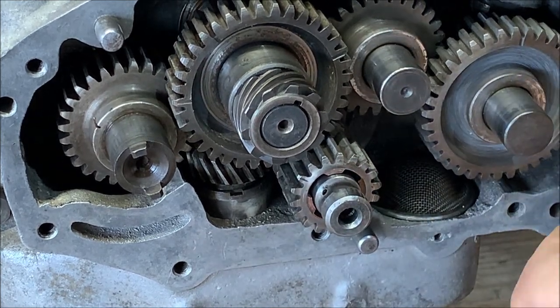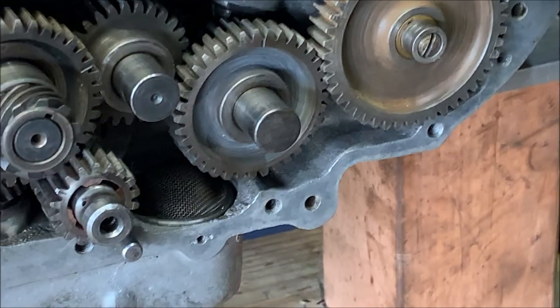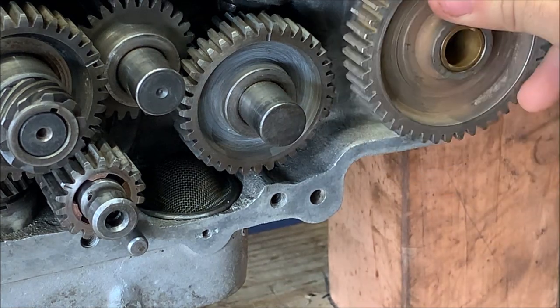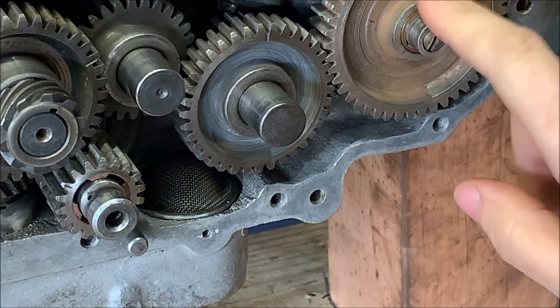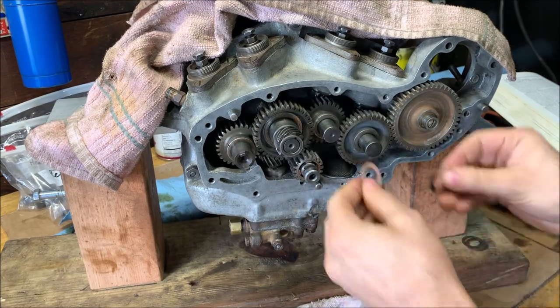And the idler gear goes in one way. You can see here. You see right there? It's stepped up now. That means I have it in backwards. So if you take it off, flip it. Now it's flush here. So that's the right way to put this on. All right, now we have all the gears in. Then the front two get an extra.